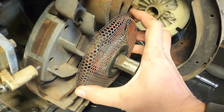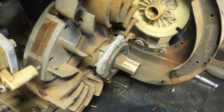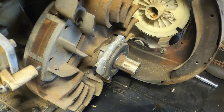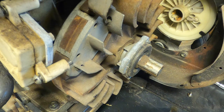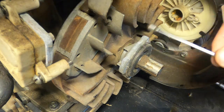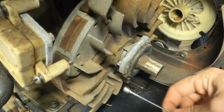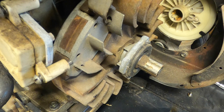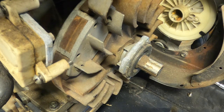The next part: the majority of the time you're going to have a cast iron flywheel. If you don't know, or if you're in a different type of engine and you have aluminum, take a magnet — if it sticks to it, that's a cast iron flywheel. That's important because if you don't have the tool I'm going to show you, you can take a big crowbar and kind of wedge it in between some of the fins.